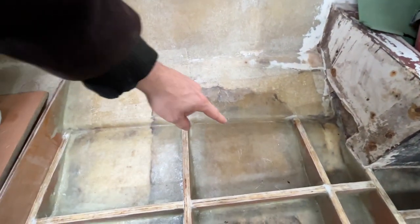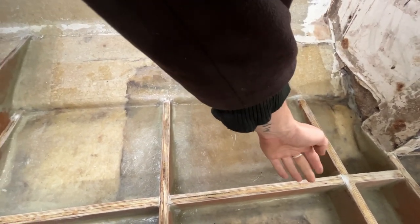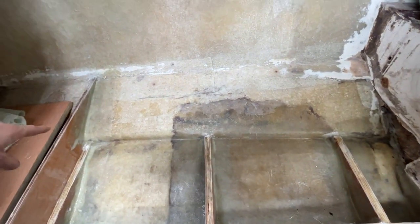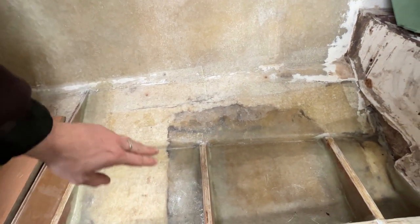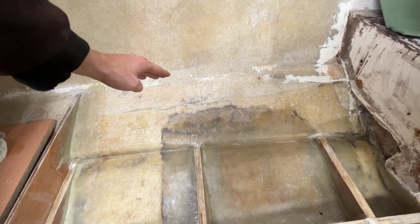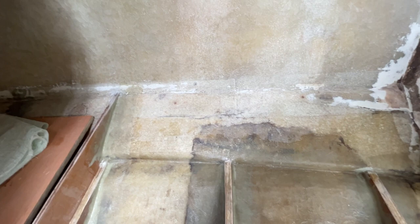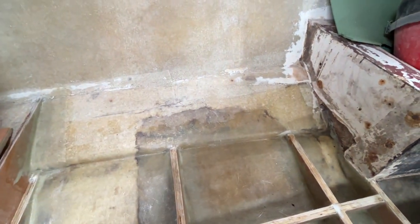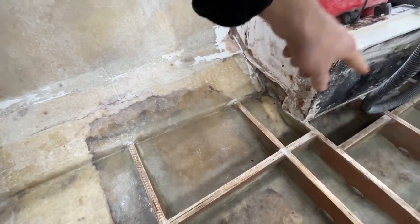This is the toilet side. I might bilge paint probably up to here and paint the inside, then try and work out if I need to do any more fiberglass to put the toilet floor in. What I don't want to do is paint it all and then come to it and think I'd have to sand it all back down. It just makes more sense to stop and work it out.